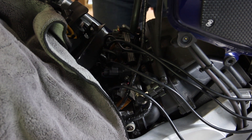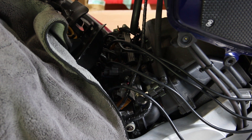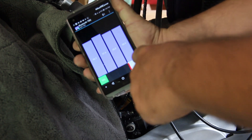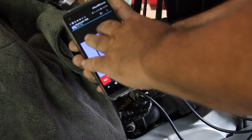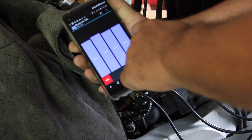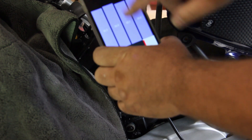Start the engine and adjust for 1,050 RPM. With the engine running, you can see cylinders 1, 3, and 4 are all running fairly even, and cylinder 2 is running a little high. Cylinder 3 is our reference, so with any adjustments you make, don't move cylinder 3 — you move 1, 2, and 4. That's just for the Gen 1 motor. Please check your manual for the proper reference cylinder.